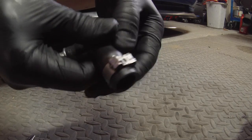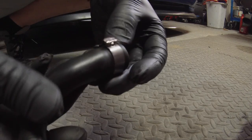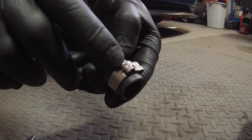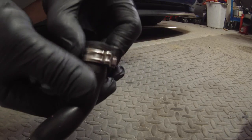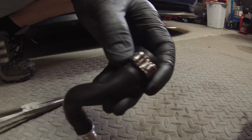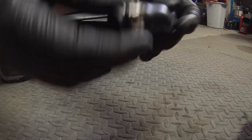You're going to run into these little clamps right here — they are a complete pain. One side is usually painted with something; here it has a little pink on it, cherry blossom red if you will for the STI. The part that is not painted is pretty much the part you want to grab because it overlaps in there. So they're a serious pain.